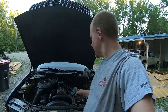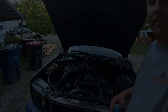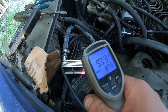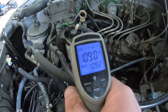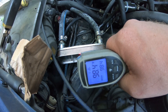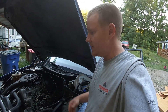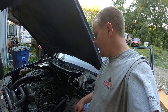Got the little IR temp gun. I'm going to take some scans of the filter head and of the heat exchanger to see if it's actually doing its job and go from there. We've got it idling right now. Currently the heat exchanger is about 97 degrees and the fuel filter is reading 109. I'll let this warm up a little bit — I've had it running before, which is why the fuel filter is reading hotter, but I let it cool off for probably 20 minutes.